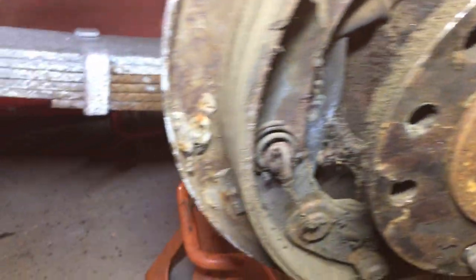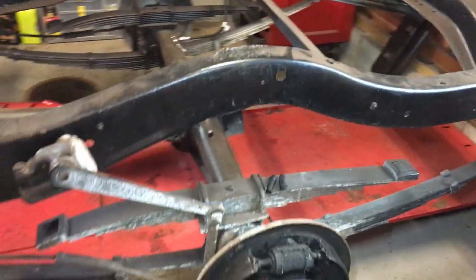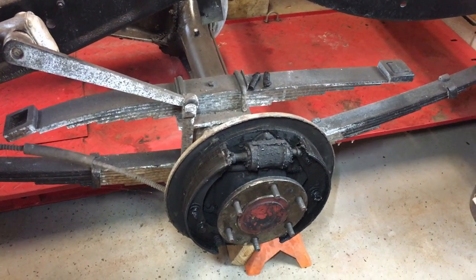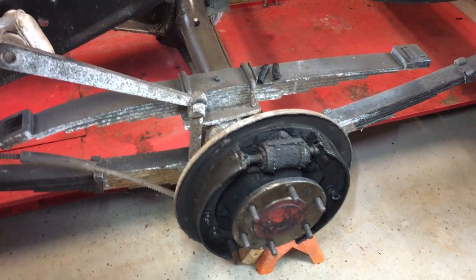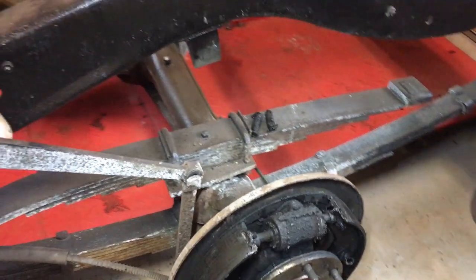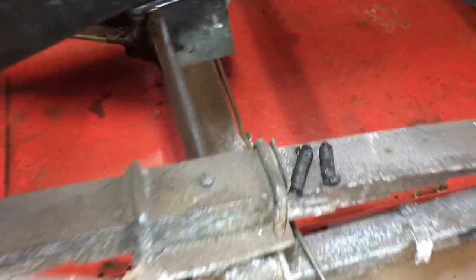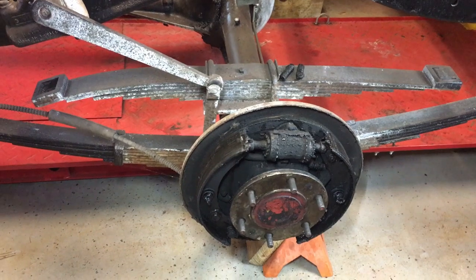This side is due for a brake job too. When I popped the drum off on the other side I was astounded to see all that grease. At first I thought someone put it there to quiet squeaking, but then I realized the seal is probably leaking from the axle and it's all gear oil that leaked in. The other side is bone dry. Also, the spring inside isn't two loose springs — it's one spring broken in half.